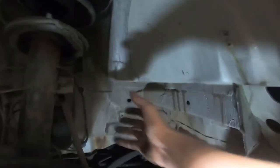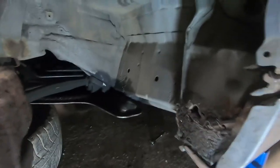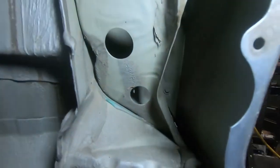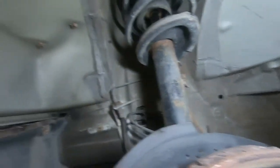I pulled this down to pull the entire thing away from the lip it sits underneath, then pulled it out of that lip — that was after I undid that one last bolt, which is a bit of a pain to get to but you will be able to get it; just flex this with your hand a bit. Next you have to start undoing the fender itself. The reason we had to pull that liner off was one, to get it out of the way, and two, there are some bolts in here that hold the fender in. There is one right here — they're 10mm — and then there's one all the way in there, one that holds it up here, and one in the door jamb.